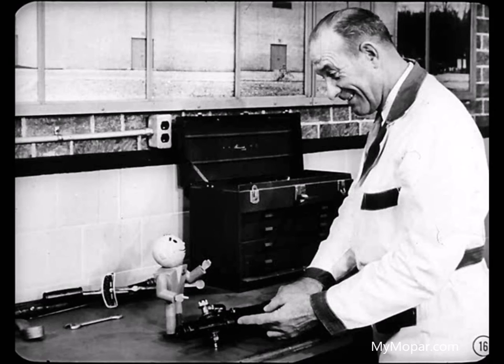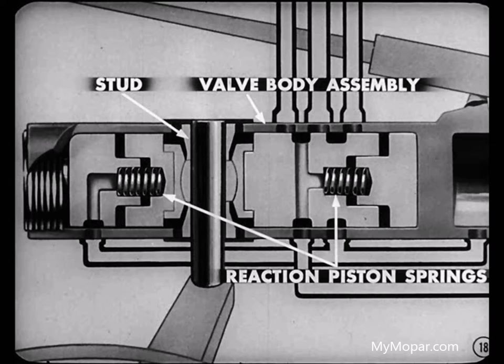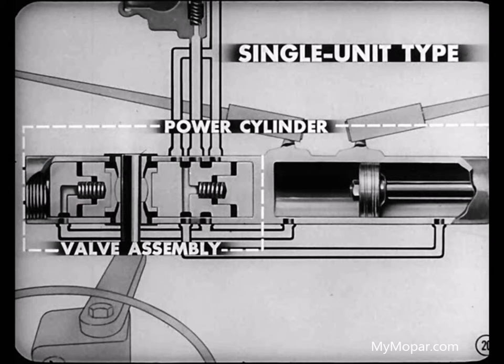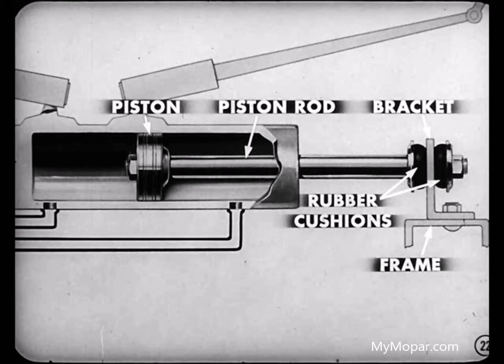Why don't you explain the details of operation using the Plymouth and Dodge 6 unit as an example? Let's take the valve assembly located here at the left end of the power cylinder. The valve assembly consists of a spool-type valve, the outer and inner reaction pistons and springs, and the steering arm stud. The stud extends through the valve body assembly and is held in the center position by the reaction piston springs. There are two replaceable steel ball seats which bear against the ball around the stud. They help to center the stud. This is the single unit type containing the power cylinder and the valve assembly, and the heart of the unit is the valve assembly, which controls the movement of the power cylinder.